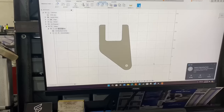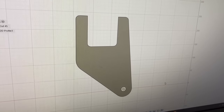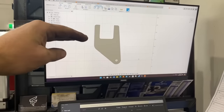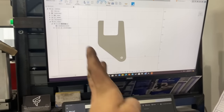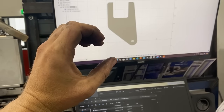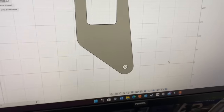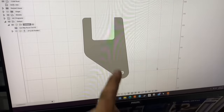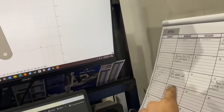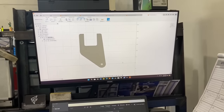Yep. All right, so we just did a quick measurement of roughly where we want the panhard rod. We went to full extension and then full bump, and sort of figured out a diagonal plane of where I want the panhard to mount, and I decided at ride height exactly where I wanted it. It was relatively between those two points. So this is the chassis rail coming through here, and then panhard, and then it drops down to the diff over here. So we'll get this guy plasma cut and we'll tack it up and have a look how that goes.